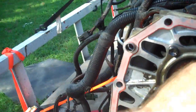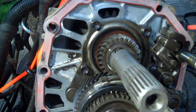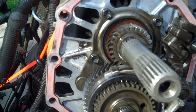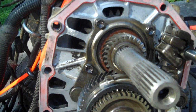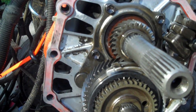Be careful when you take that bearing out — you saw how easy it was for it to come out. Lay a rag over top of it or something to catch it when it comes out so you don't lose it, because if you lose it you've got a problem. At this point, we've got to clean up all of our gasket surfaces. I'm going to run up to the auto parts store and get another seal that goes right here on the output shaft. You've also got to make a gasket for the transfer case side — clean it up, get some gasket sealer to go around that, then put the Wrangler tail housing back on. It'll be ready to drop into the Jeep.